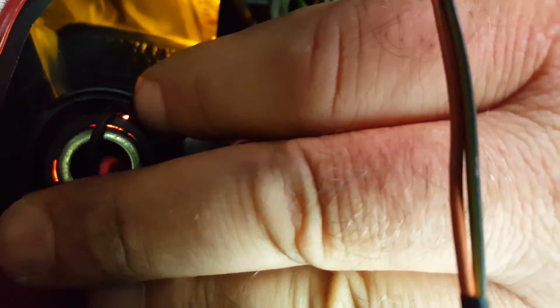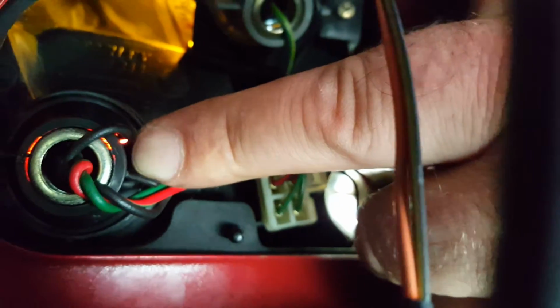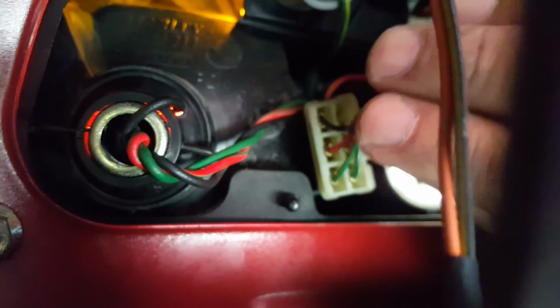And to put it back in again, you need to align the single lug with that small hole at the end there, look. And then the two lugs that are together go in this long groove. And it really isn't easy to film and to do at the same time, so my apologies for that. Okay, once those lugs are in place, then all you have to do is rotate the holder about 15 degrees clockwise. There we go, job done.